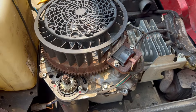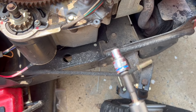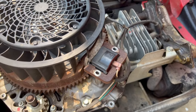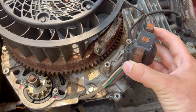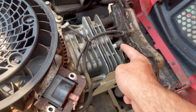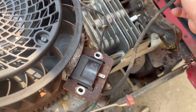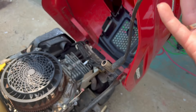This one is very rusted — this lawnmower has been sitting outside pretty much all year. You're going to use a number 8mm and unscrew these two bolts. I already unscrewed them just to make the video shorter. Once you unscrew it, it will look like this — completely rusted out. Next, remove this and unplug it from the spark plug, unplug the white wire as well, and the coil switch should come off with no issues.